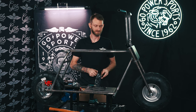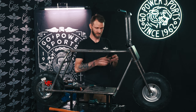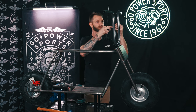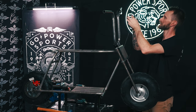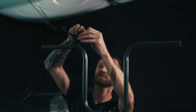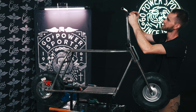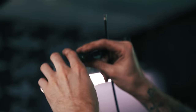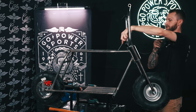Next, brake lever. The brake lever is going to go on the left side of the handlebars. You can let it hang because you still have to put your kill switch and your grip on — you want it aligned nice. Brake cable is pretty simple, just like a bicycle. Line it up in this hole over here, spin it around, then spin it to where this slot doesn't line up so the cable doesn't fall out on you. And then you can just set your cable down.